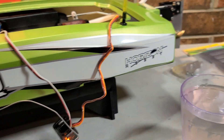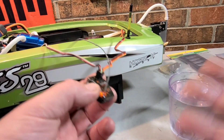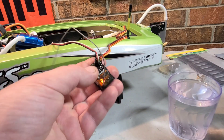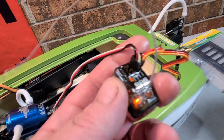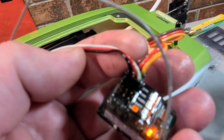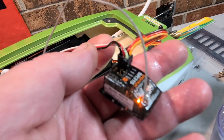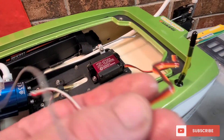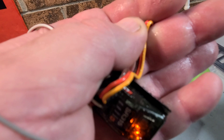I've had a lot of questions lately regarding waterproofing in a boat and I figured that's the best way to do it. I may make another video where we dunk a servo in the water after treating it with Corrosion X — maybe one of those little cheap micro servos. That's basically all I do. Now I should warn you: if you get too much Corrosion X on the wires, it will make your wires kind of hard and stiff. That's the only downfall. Don't get Corrosion X on plastic holes either — it may make them brittle.